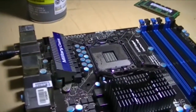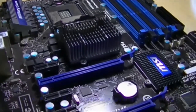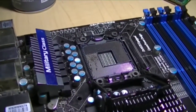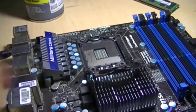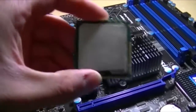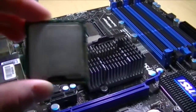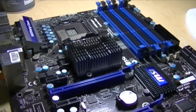I think the first thing we're going to do — and this may require sending this motherboard through a trip to the dishwasher — is try to clean this socket out with some electrical contact cleaner. We'll see where we can go from there. Hopefully the contact cleaner will be enough to clean off whatever grime is on here, but if we have to stick this baby in the dishwasher, I guess we will. Just as a backup to the Xeon, I have an i7-920 that we ordered at the shop for another person. I've tested this and it's a working processor. The Xeon, on the other hand, I tested on the same HP motherboard and the HP motherboard did not like this processor. So if this motherboard decides it doesn't like the Xeon, I at least have a known working processor to test it with.